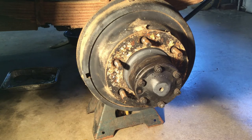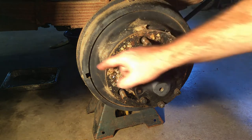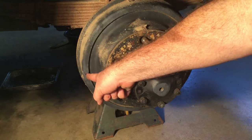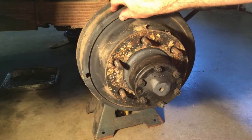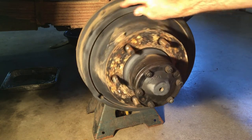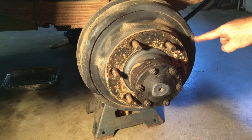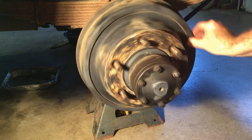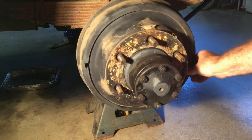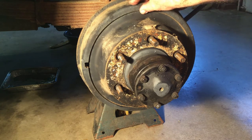Students may ask: do you have to take off the drum brake here to inspect your brakes? That's an awful lot of work, and the answer is no. You have a little inspection hole right there — you can shine a flashlight in there, spin your drum all the way around, and look at the lining to see how much is left. You can actually get a feeler gauge in there and measure the clearance between the drum and the brake shoe to see if they're out of spec or need adjustment.